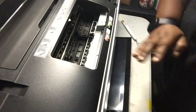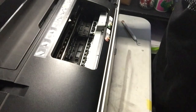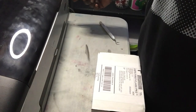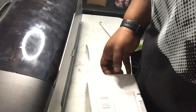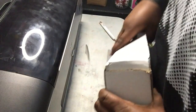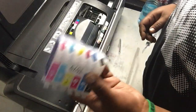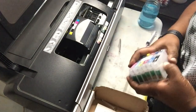I've got all the wheels out except for four total — two in the front, two in the back. Now I'm going to flush out the ink that's in here with cleaning solution. Right now I'm getting a blinking ink button, which tells me one or more of the inks are empty. I've got some refillable auto-reset cartridges here — the first set I'll fill with cleaning solution to flush out the old ink, and the second set I'll fill with ink.